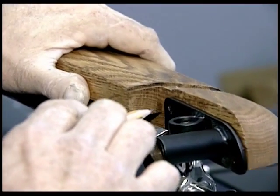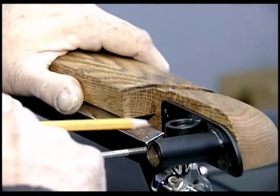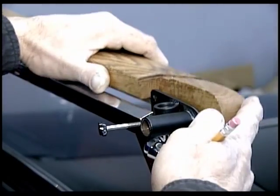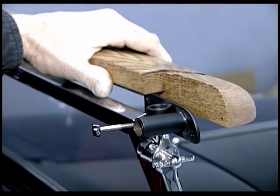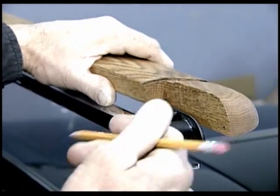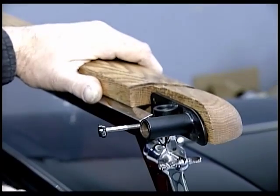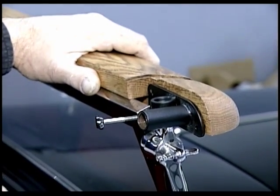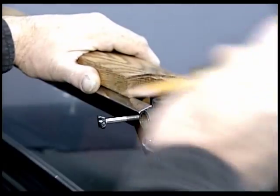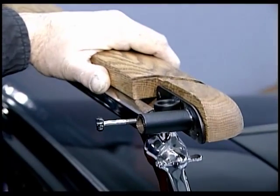You want to center this header bow between the two header mounts. There are instances where the windshield is too narrow and the bow won't fit down between the two head pieces — in that case you may have to take a little bit off the header bow with a saw. It's no big deal; it's pretty rare because most windshields are the same width apart, but it may come up. Once we've marked our holes, we go over and drill them on the table, bring it back, do the same thing to the other side, and the header bow is mounted.